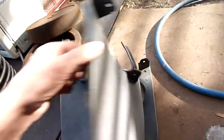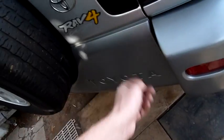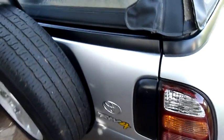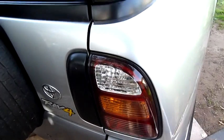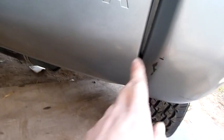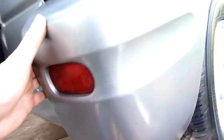I'll spray it with the polypropylene conditioner and then spray paint it black — a bit of matte black epoxy or something. You can paint polypropylene but you must get the proper adhesion promoter designed specifically for automotive bumpers and things like that. It's professional grade — about $18 for a regular spray can but it goes a long way, generally two coats does it.